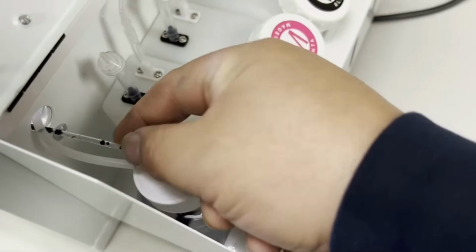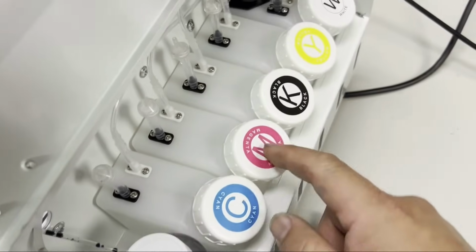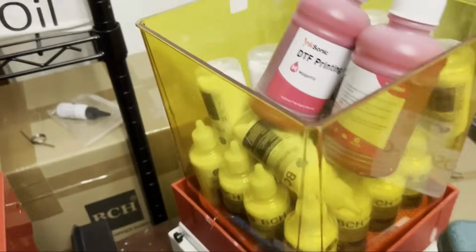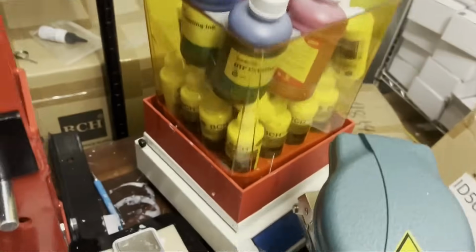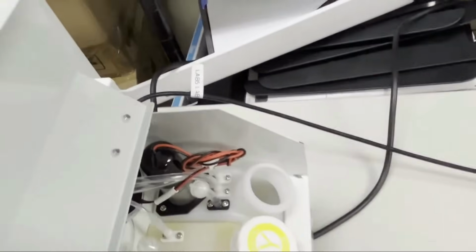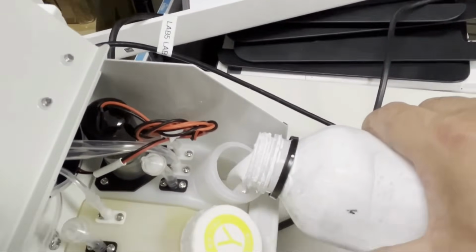This is the waste tank. The smaller tube is from the capping station, and the large tube is from the print and maintenance unit. We're going to fill in those with ink. I suggest you invest in a shaker or roller. I have another video about how to modify a rock roller into an ink roller, which I'll put in the description section. I only use rolled white ink. That's why my white ink never clogs. So for you right now, you just want to shake every ink before you add them to the tank.